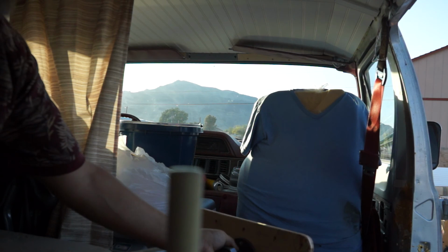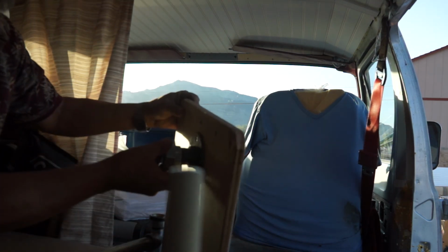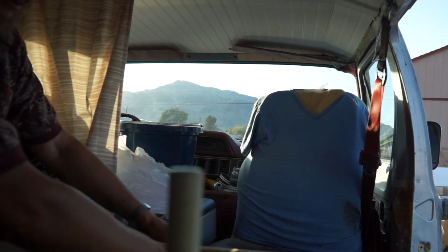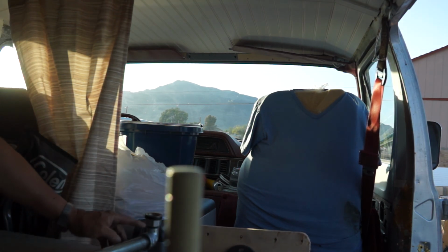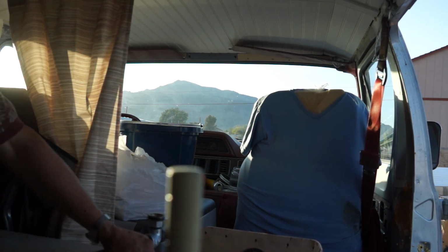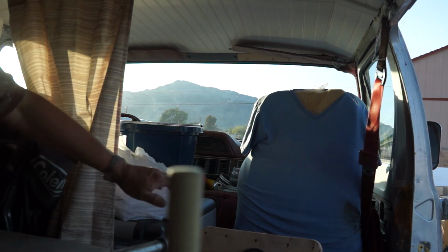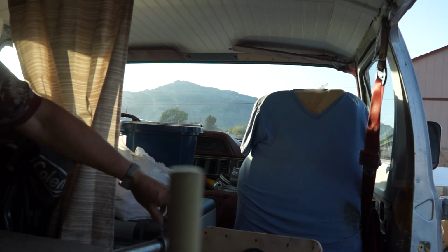I've seen other videos where people have just, oh, this is a flange, a pipe flange fitting. It's real common that this closed nipple is screwed into. Some people just use what's called the street elbow here. That's what this is actually. And then they just screw this into the flange fitting. But the problem that I see with that is after it swivels a few times, those threads will tend to get loose because they'll wear on the threads.